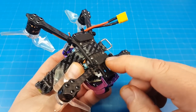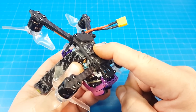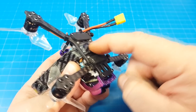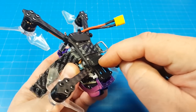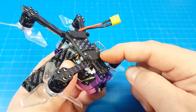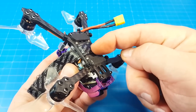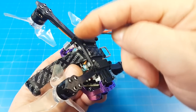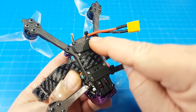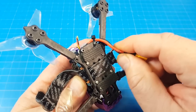Two last details. I double stacked their battery mounting pads because of how they routed the battery strap — it comes over the top of the carbon fiber. I like getting the battery onto rubber pads, and since they gave us extras I double stacked them to keep the battery secure. Re-threading the strap is a bit of a pain because motor wires go underneath the ESC in a tight space. I also used the little space at the back to secure the battery lead down.